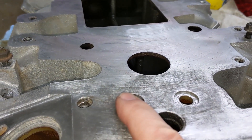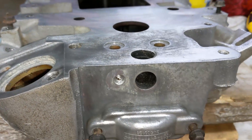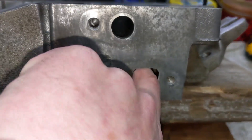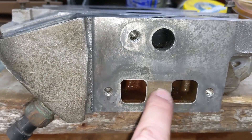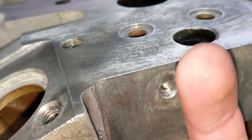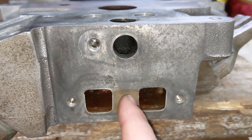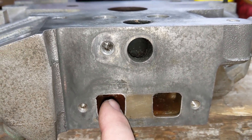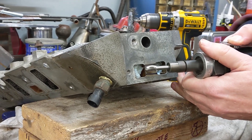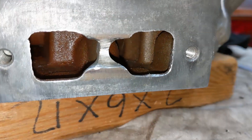Now, we can't just go and block the coolant flow between these two, because this is designed into the cooling system to have coolant flow through here. There's this cap on the end — we'll take this off quick. You can see there's two holes here, and there's a wall between the two, so they are not connected in this direction. What we need to do is take a die grinder with an aluminum bit and carve a channel in here, so the coolant has an alternate path, so that it continues to cool the lower intake manifold as designed by GM. And that's going to work just fine.